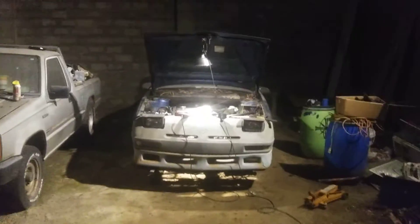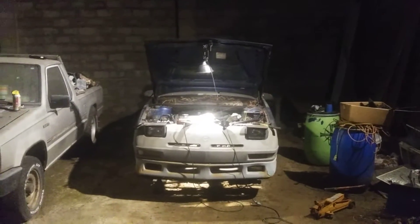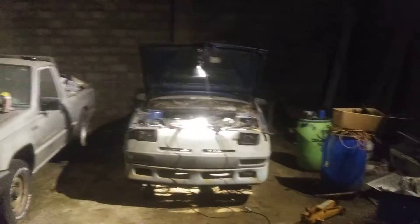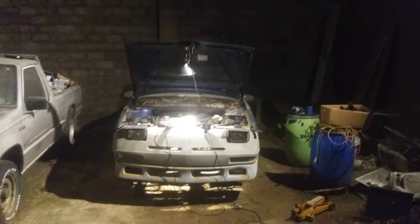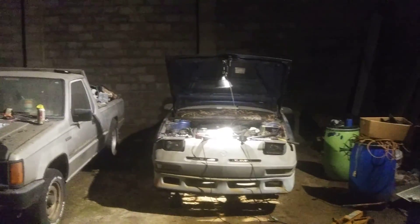Well, there you have it — that's about what we're doing. Hopefully I can get this motor and transmission out of here without too big of a fight and find a good home for that. The transmission slipped a little bit until I put some Type-F Ford fluid in it, and it just sort of started cooperating. The thing ran really good toward the end — it burnt the cheap ignition module out, then it set overnight and froze and I didn't let all the water out like I thought I did. But the block's still good, the block holds water — just that water pump thing doesn't. If anybody needs a 2.5 engine and a 3-speed automatic, here should be. Well, that's it for this update. I shall see you next time. Bye-bye.